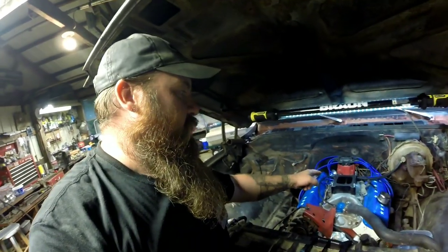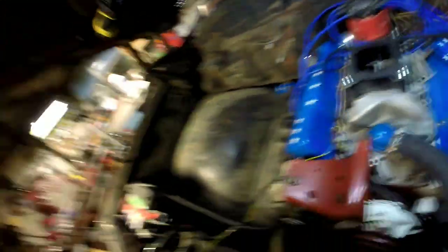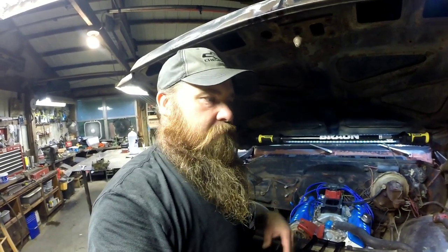As you can see I've got a big 2-inch spacer on top of my intake. This is just a get-me-by — not something I would really suggest 100%, but as per everything else with this whole project it's kind of budget-minded. This is the intake I had sitting on the wall. I didn't have a good open-plenum intake like I really need for this application; eventually I'm going to get one. I've been hoping to find one real cheap on the marketplace, but for right now to give me more plenum volume I put that 2-inch spacer on there.